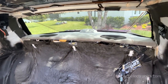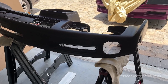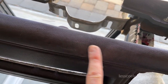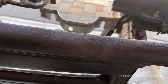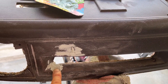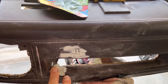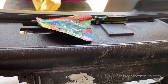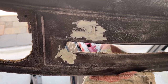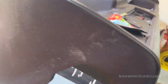The first part of the new interior is installed in the Monte — very exciting. There's the back deck wood, I love it. This is going to be so radical when it's done. Now I'm up to prepping the main dash panel. This whole dash pad is in basically really good shape except there's a low spot I exposed by sanding horizontally — I'm going to fill that with Bondo. One of the top 7mm screws really gave me a hard time, so I cut around it and pulled it out with a vice grip, then filled it with Bondo.